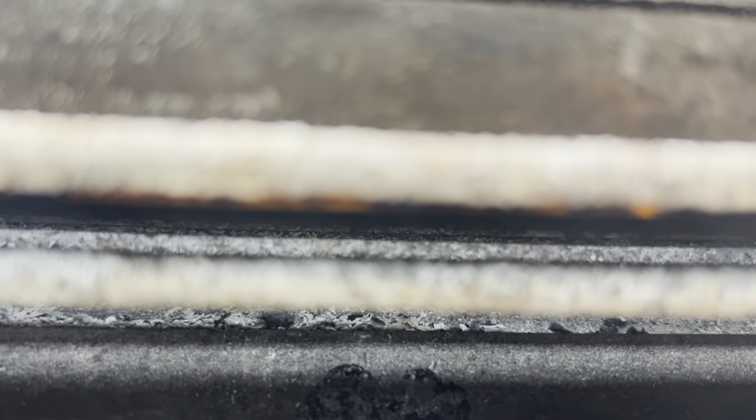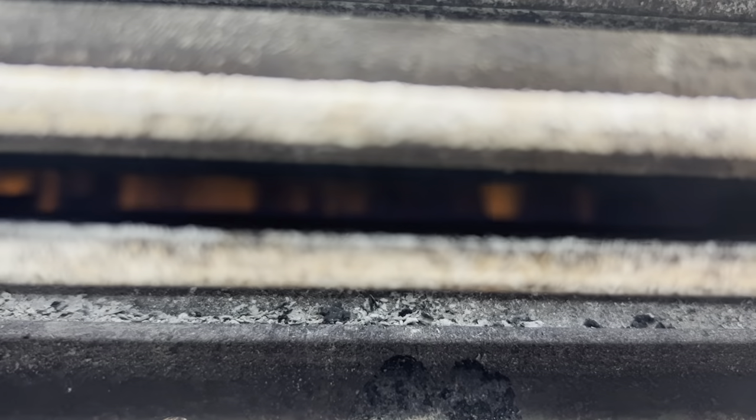Alright, we're going to run a quick experiment. We have it on — we have our old, gunked-up blower running. Let's see if we can get a good look at the flame in here. See what she looks like as the chain comes around — look in there. You've got kind of just a staggered, weak flame. Nothing to speak of.